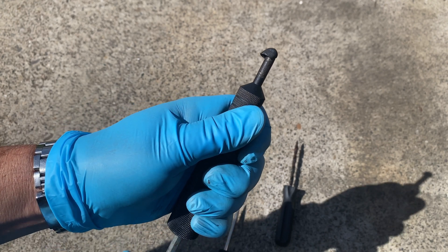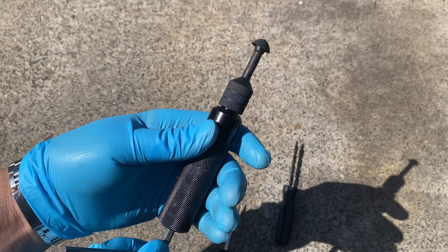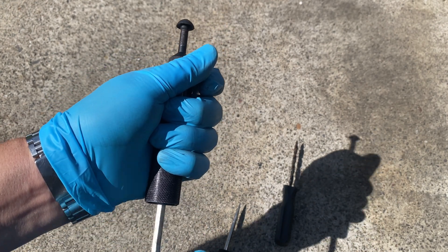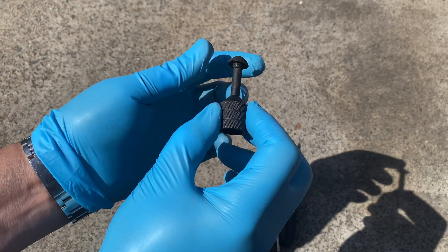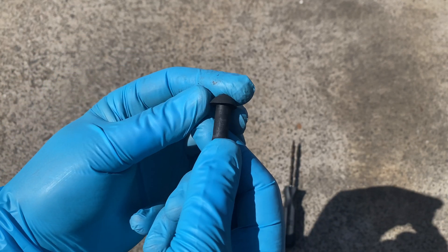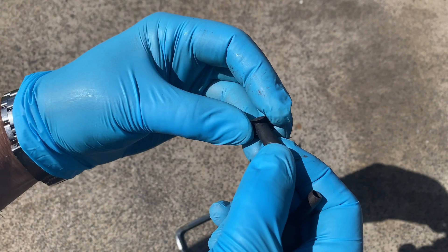Imagine this is inside the tire now. We twist and twist until it stops twisting. When it stops twisting we've bottomed it out — we'll know that it's the end — and at that point, remember this is inside the tire, we can back this out and then unscrew the handle and essentially pull this out. You can see it's in there quite snugly. So this little mushroom will be inside the tire. What it does is when you pull it, it flattens this little hat against the hole in your tire.